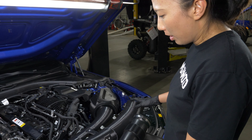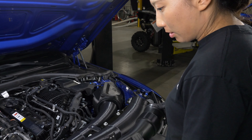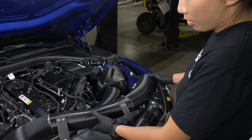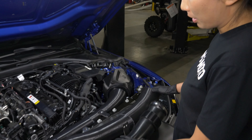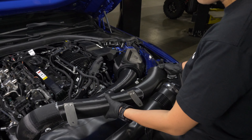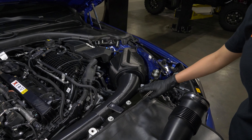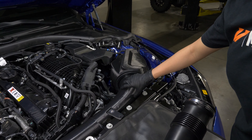The reason for replacing the one turbo snout is to minimize the bend in the intake track so we can maximize flow. This is the intake tube we're investigating on the driver side — this is the stock intake tube and this is our initial design. We found on the flow bench that there's more potential flow by further increasing the diameter of the intake tube, which is why we designed a second version. We pretty much use all the available space to maximize flow.